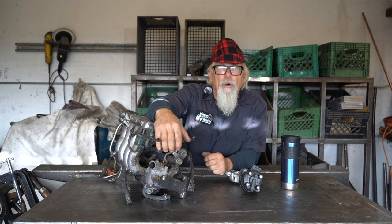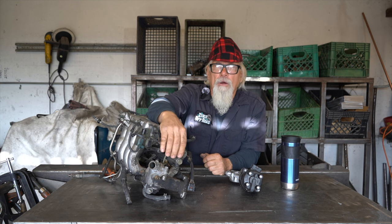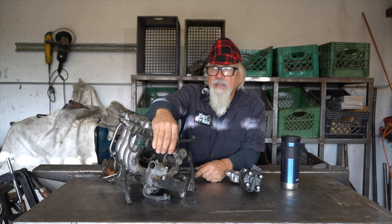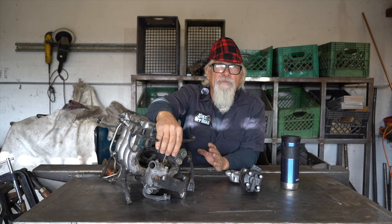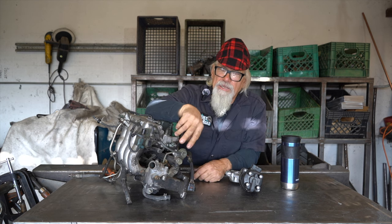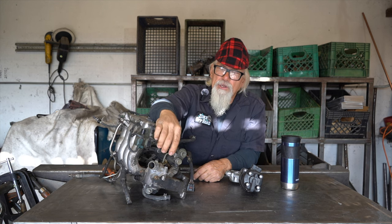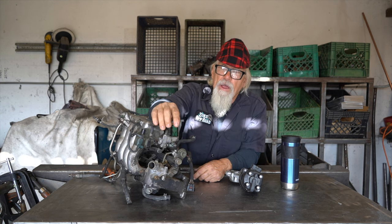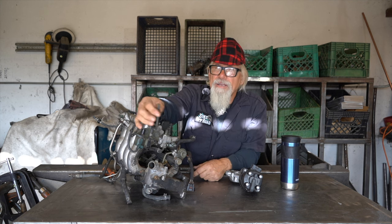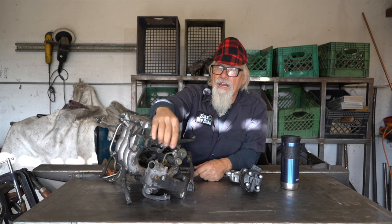The problem is that there aren't any very good ones - most you're going to buy are from China, unfortunately, so it's kind of a hit and miss. I'd recommend O'Reilly's over all the other companies that sell these pressure regulators. It's two bolts to take it off, the return line clamp, and the vacuum line. If gas is leaking out because the rubber wall has been compromised, it's going right into the plenum through the vacuum line - that's a direct line, no valve.